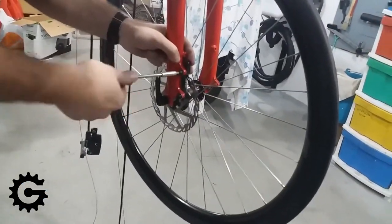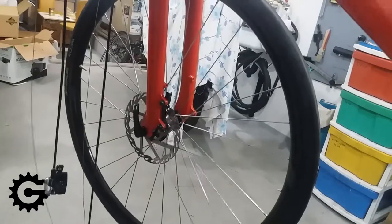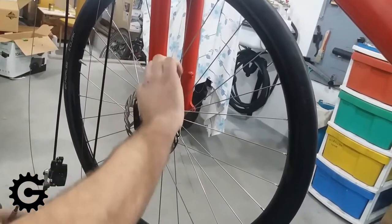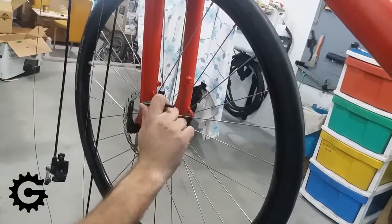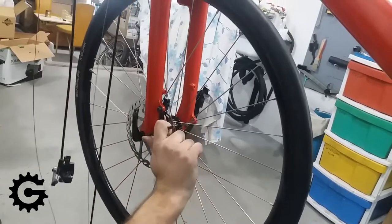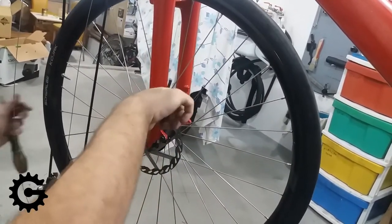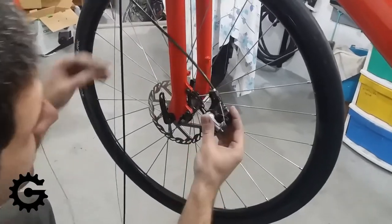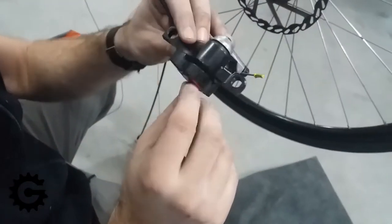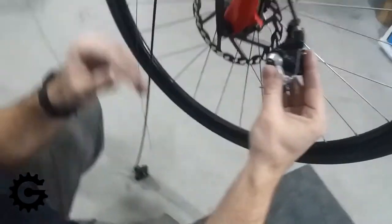The caliper is just not tightened by a large amount yet. Finally, all the bolts should be tightened to the proper torque specified by the manufacturer. Here I am demonstrating how you can use your hand if you have good feel — if it is metal, not carbon components, there is lower risk of damaging anything. By holding the allen key halfway and using a decent amount of strength, you will not overdo it but it will be firm and nice.